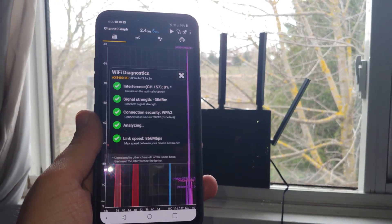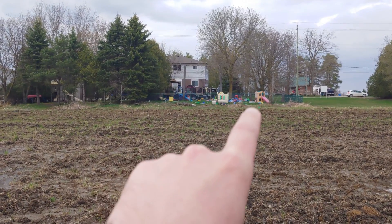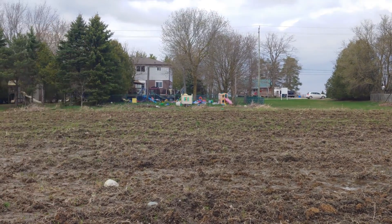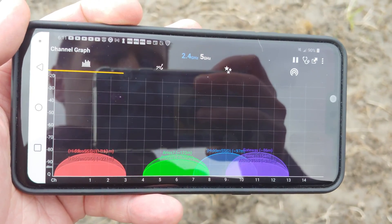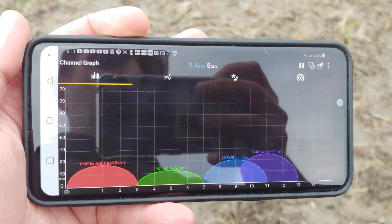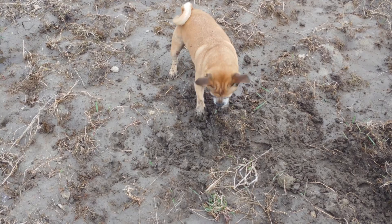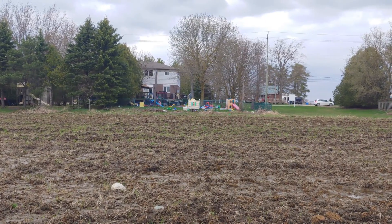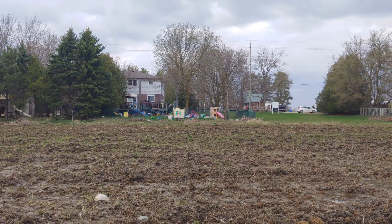Hope the Canadian geese don't kill me — see how far my range will get. Wi-Fi analyzer says I'm connected at just over 100 megabytes a second. Y'all better smash the like button for me for being out here. The access point is sitting up here and I basically have no 5G signal. We got to remember that 5G can't penetrate walls or windows very well. Here's the 2.4G. This is about the point where the Wi-Fi always cuts out and the range seems to be standard on these things — the only difference always comes down to how much data they can push through, and this thing can push a whole lot of data.